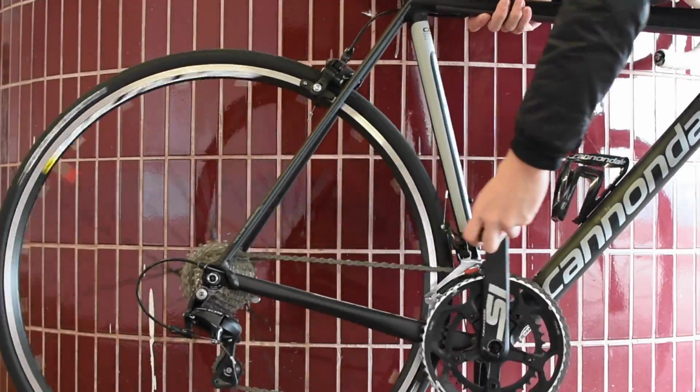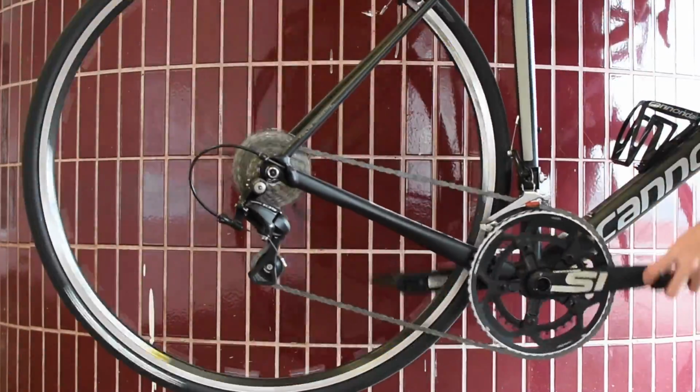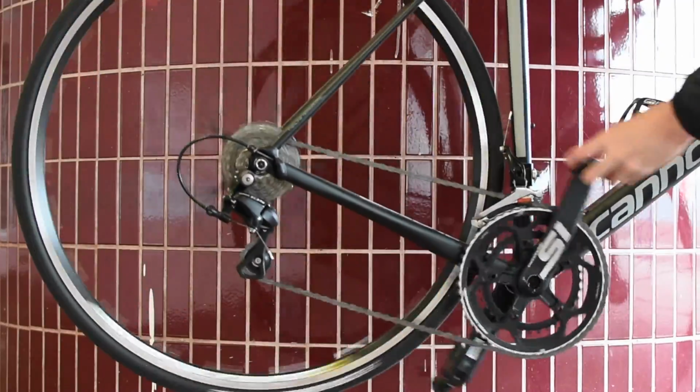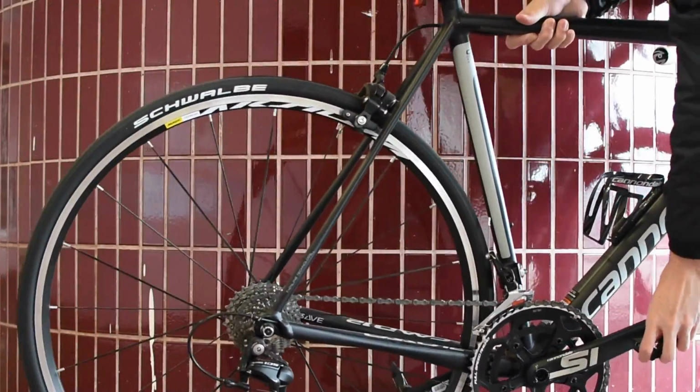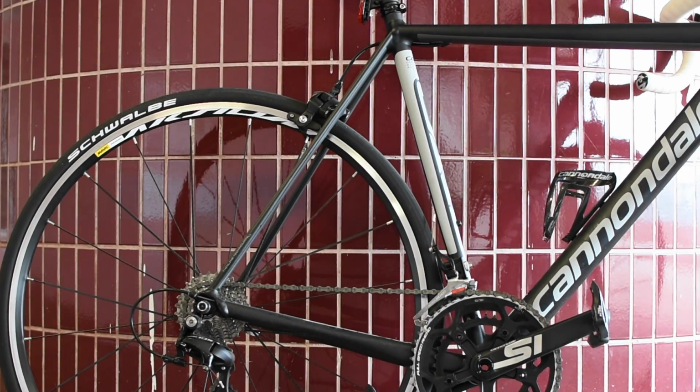Checking your shifting system is important to your bicycle. If the gears are not functioning properly, it could skip a gear, or even worse, the chain could accidentally shift onto the hub and cause you to crash. Check chain tension by shifting through all the gears on the bike on both chain rings in the front.